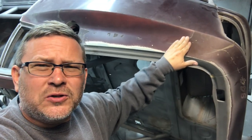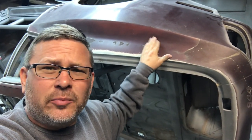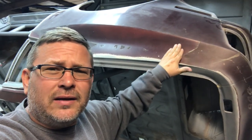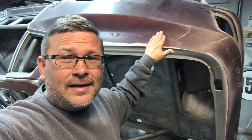You can see here where the clear is peeling off this old paint. That's the main reason we're going to be stripping this paint off, back down to metal — if I just sand it and feather it out, this clear comes off and takes my paint with it. So we're going to strip this down to metal, fix any dents, and it'll be ready for paint.